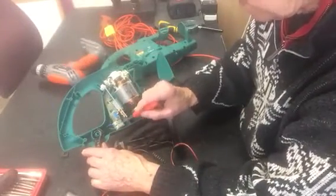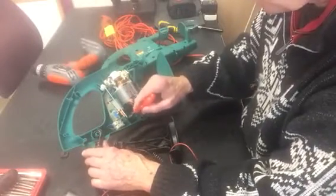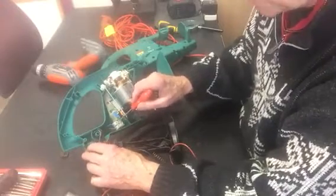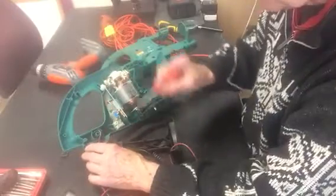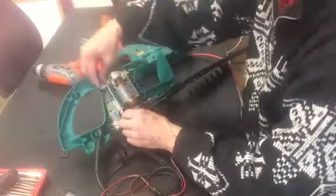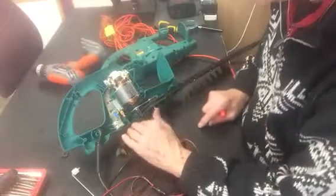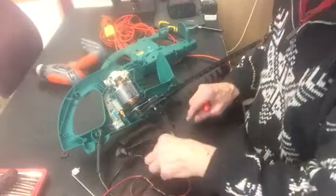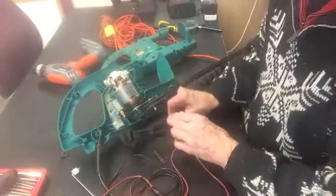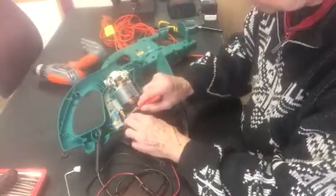We're going to check the lead with the meter there for sure. We've got an interference suppressor which goes across the mains to suppress any spikes when this is operating, so it doesn't go back down the mains and make your television buzz. And then we've got this lever here, which connects our two on-off levers, which work in unison with each other. I won't say parallel because that could cause the electrical thoughts confusion. So our levers work in unison with each other to operate this rod, to operate this on-off switch here.